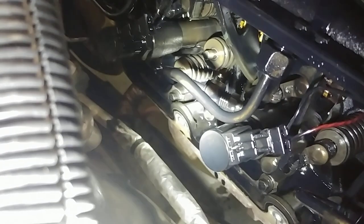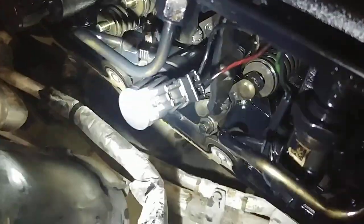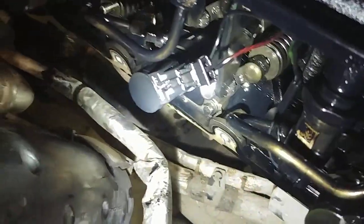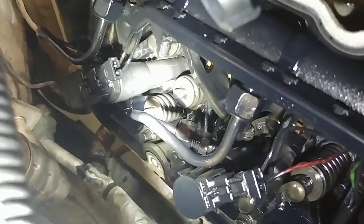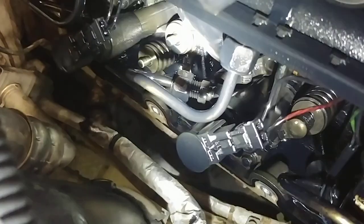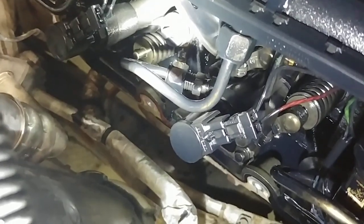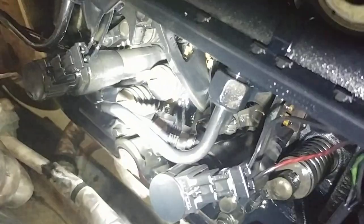So we probably could use a little more oil changes. Let me climb up here. So what do you see wrong here? I see two tops of valve stems that don't have anything connected to them. Son of a bitch. So there is a chance we could just put a full set of rockers on it — that's what I would do. But we need to look at the lobe lift and make sure the camshaft and the lifters are okay. You can see it right there — those two right in the middle. Rocker fell off.